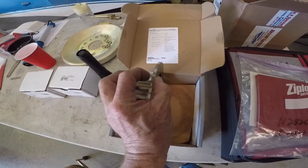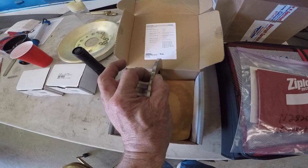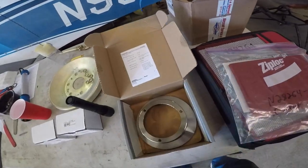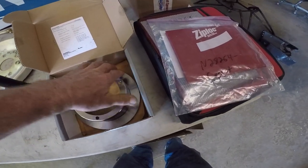You can wear these things down to 0.204 inches. Once they get thinner than 0.204 inches, they've got to be replaced. Rapco is one option, and so you get to see a nice new shiny brake disc.